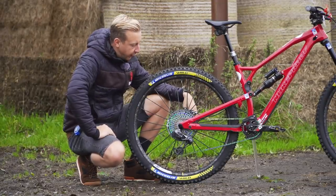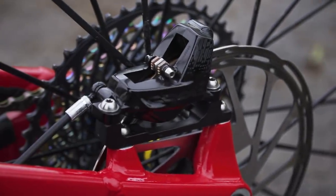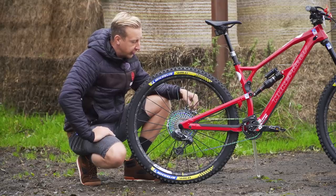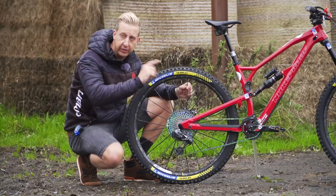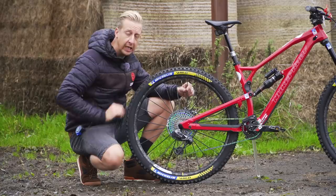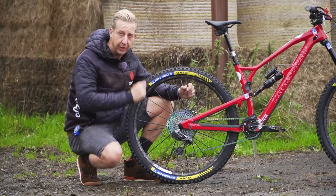Out back, things are a little different. He's running a 29 inch rear wheel — there's no mullet version of this bike for Sam currently. He's got 200mm rotors and Code calipers again, running sintered pads front and rear, though that would change depending on preferences and conditions. The D-Max Pro wheels are set up tubeless with the Nukeproof ARD system. The rear tire does switch for different races — usually those DH22s — but here he's actually got the Wild Enduro rear tire, which is slightly firmer, measuring around 44A.